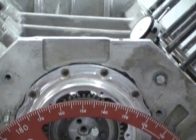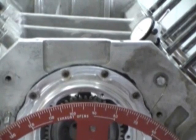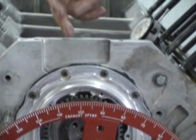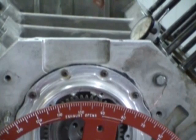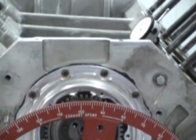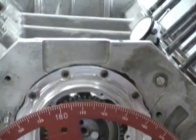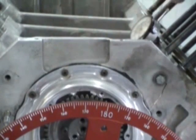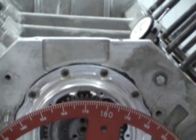Make sure all your stuff is tight so nothing's moving. You're going to back it up about 75 thousandths, then come forward to 50 thousandths. What you're doing is taking any slop or backlash out of your hub or whatever you have going on. Now it's at 50 — that's 50 thousandths before peak lift. Look at your indicator on your wheel: we're at 70. Now we go past peak lift, it goes to zero, and we go back down to 50. So we started at 50 thousandths before peak lift, gone over peak lift, and now we're at 50 thousandths past it. We read the number, which is 162.